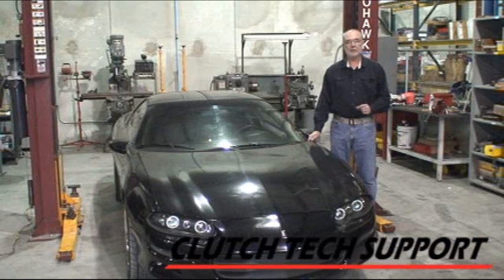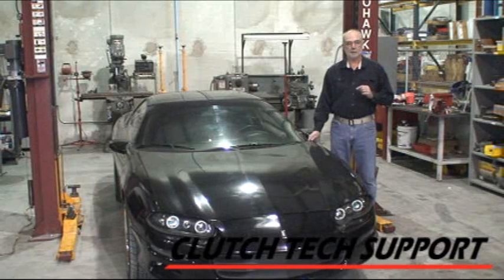We got a nice crisp pedal. Having a little bit of experience, the right technique, and in this case maybe a little bit of a special tool — that vacuum bleeder — we got a nice crisp pedal. It's very important to have a good crisp pedal and a good clean release with reserve travel. If you have any questions about a clutch hydraulic release system, clutch system, or a flywheel, please call us toll-free at the Clutch Tech Support Hotline.